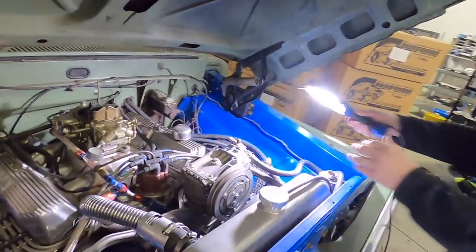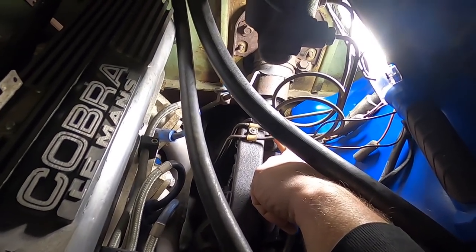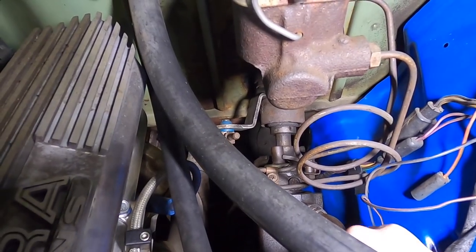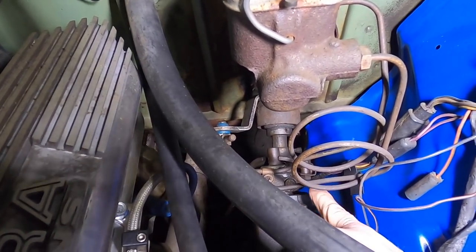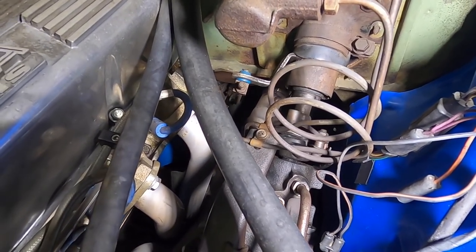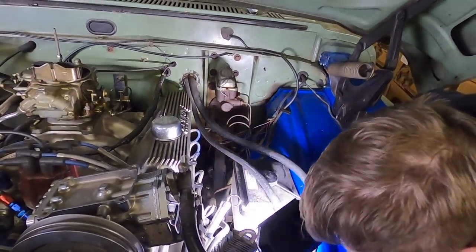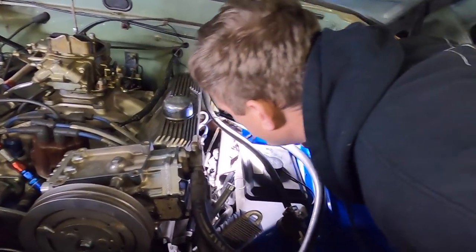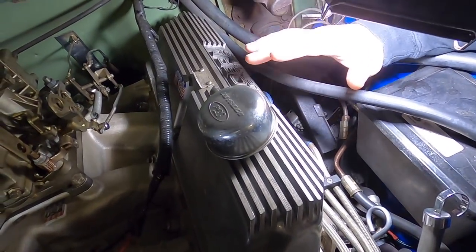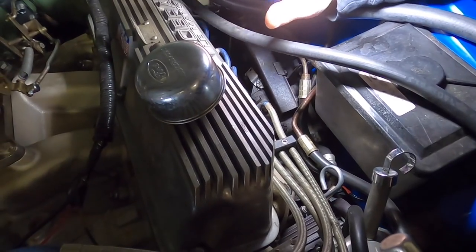I think you've got a bad steering coupler — look right here. I'm going to rock the steering wheel. There's actually supposed to be a chunk of plastic or material right here, but this piece is loose — it's busted apart. It's called a rag joint and it's supposed to absorb steering vibrations. You can see all the slop and play in the steering. We need to replace that — it's really moving, pretty considerable slop. That'll tighten up your steering a lot.